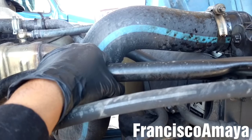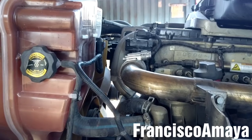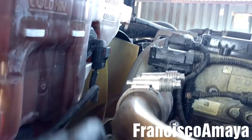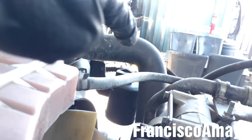To remove the bars that hold the radiator brackets. Now I'm going to disconnect the sensor — the coolant level sensor. I'm going to remove this hose, this other hose right here, and the other hose.